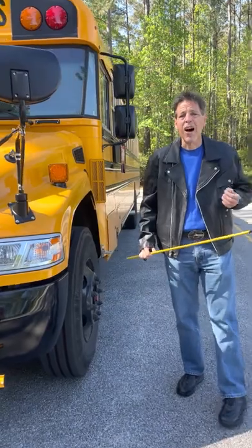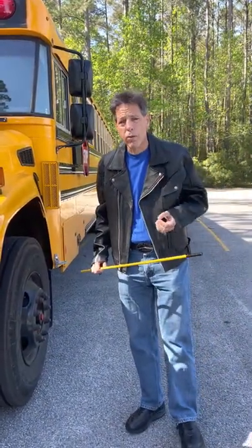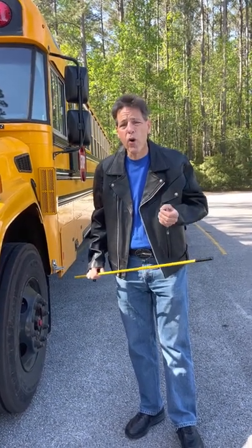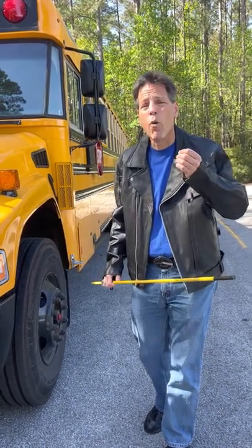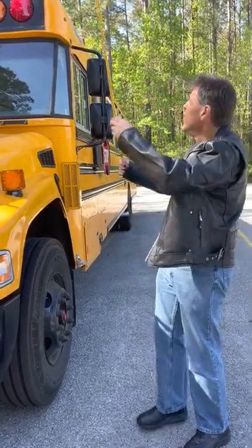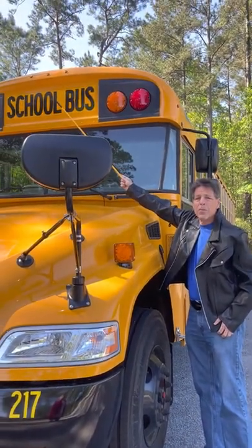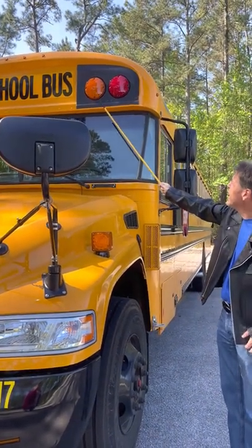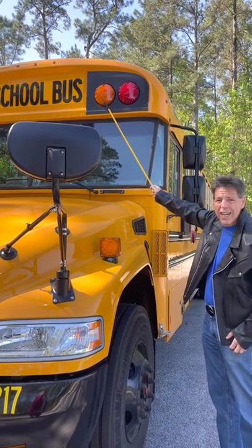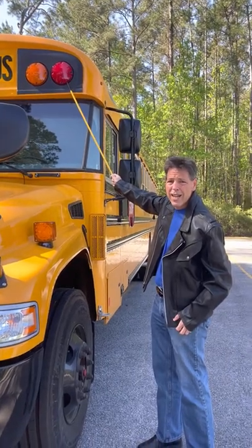All the lights are securely mounted, none of them is missing nuts or bolts, none of them is cracked, broken, dirty, or missing, and none of their rubber seals are worn, torn, cut, or frayed. The lights include the clearance lights all the way on top, amber in color, the eight-way flashing lights on each side, and the warning lights in amber and the stop light in red.